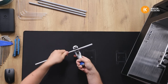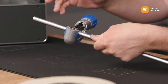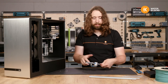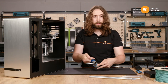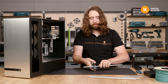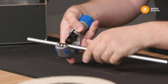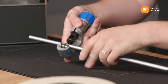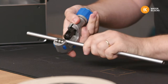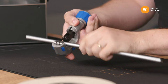We went with this tubing being not 10-12, but around 10.5-12, because if we had too much thickness, then cutting it like this is a problem. And if it's too thin, then you can collapse the tubing. It wouldn't be strong enough, and you make it elliptical, and it will leak in the fittings. So this middle ground seems to be working really nice. This was our first try. And I think I'm enjoying it more than making the acrylic, to be honest.